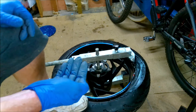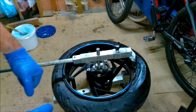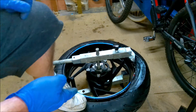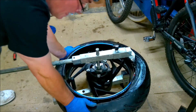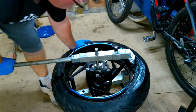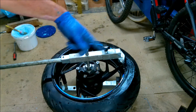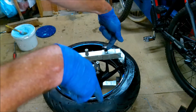Just keep this top edge inside that wheel rather than up on its bead and it gives you so much more room. If you find that you're using two hands and ten people leaning on the tool, you're definitely letting it rise up into the bead. This is so easy when the tire drops down into that center bit of the wheel. The rotation is that way - so the bit of the tire that's out is on the back and is the last bit to go around.